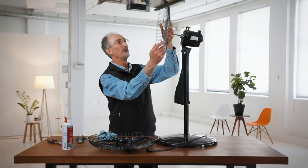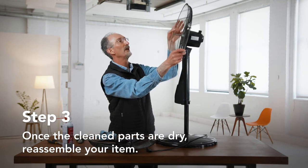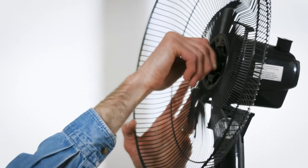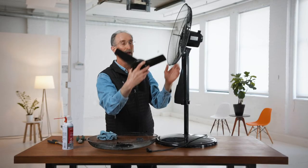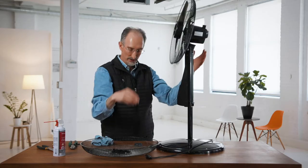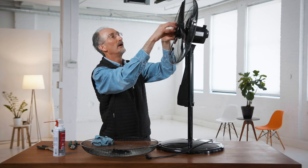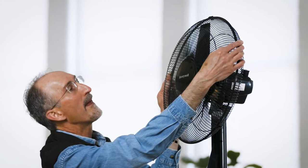Once we've cleaned all the parts and let them dry thoroughly, we can put them back together. There are a couple of pins on here for this assembly, so we make sure we get the pins lined up, put the nut back on — in this case it's clockwise to tighten it back up. Make sure it's on there properly and secure. Put the blade back on; there is an indent on the shaft so we want to get that in the right spot. Once you see the threads, you can put the nut back on — remember to turn it the opposite direction from normal. Then with the clean cover, put it back on and clip those clips closed.